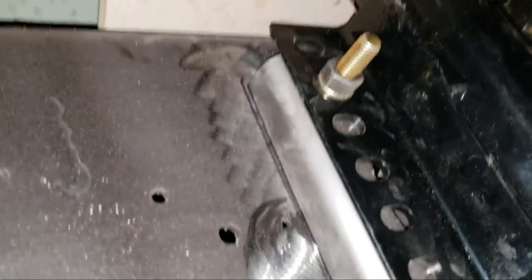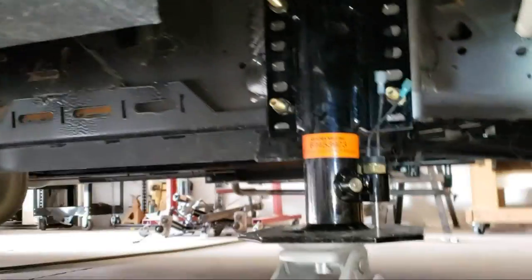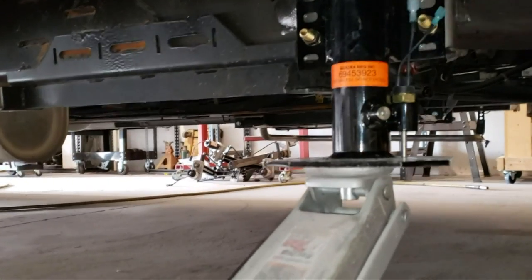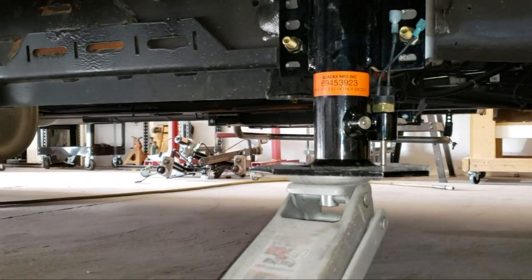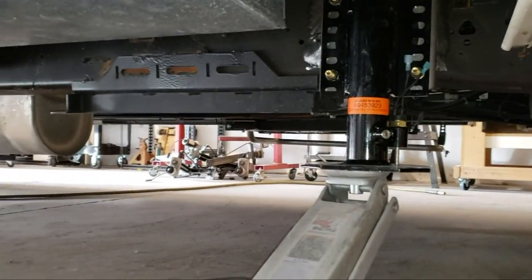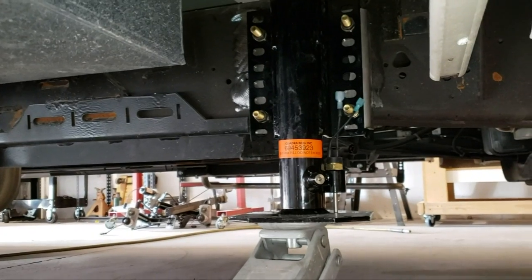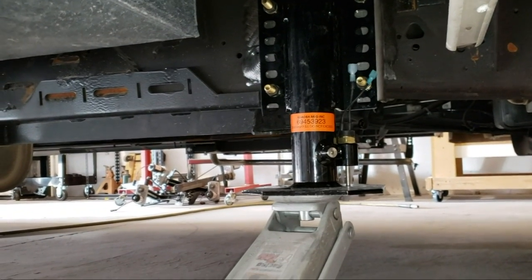House batteries disconnected. I got the front jack marked up, already prepped the frame right there. This jack is only about 12 inches or a foot long, and I want to be able to have it touch the ground. The height where it is right there is just about even with the muffler, so it's not sticking down any further than anything else - especially in relation to the other jack that was there to begin with. I'm pretty pleased with how this looks, should weld that pretty easily. The back's gonna be more of a pain.